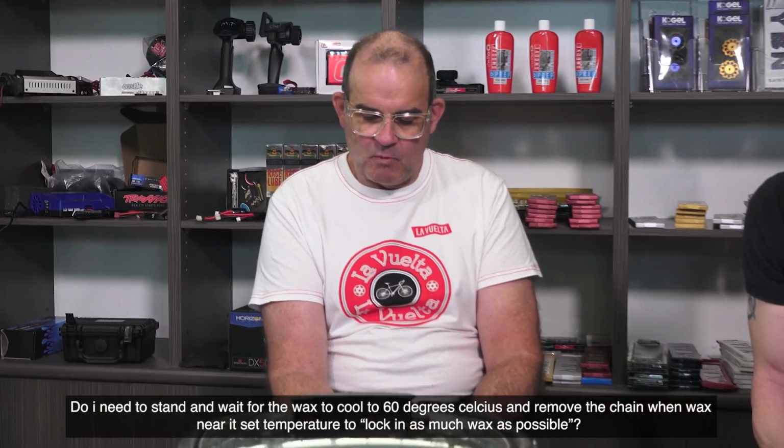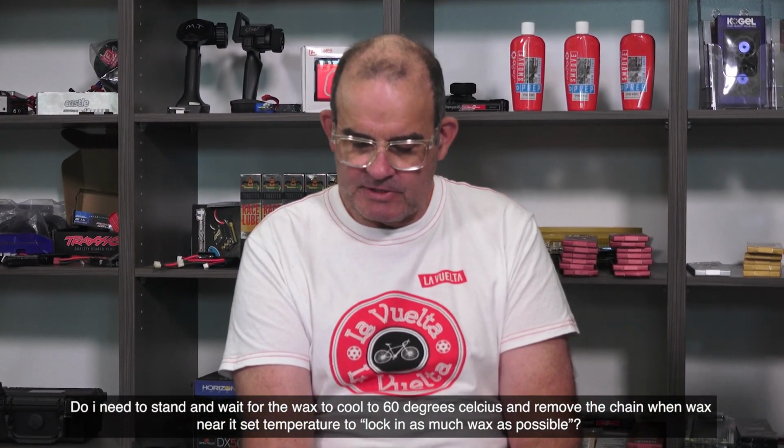And so really, again, the best thing for that is it just comes down to rewax frequently. As soon as it gets out of that silky smooth zone, just rewax frequently, or you may want to help, just do that with, say, a UFO drip or Silca SS drip. Just reapply frequently to keep it nice and silky smooth. So that's just pretty much how those chains are. If you've done the prep right and it's sounding noisy and dry really quickly, it's pretty much always going to be that.